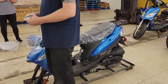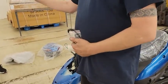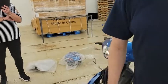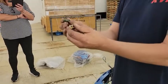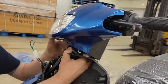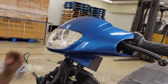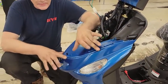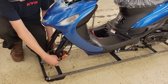The bolt holds the steering assembly together and a collar — the bolt is funny shaped, it's flat on one side and beveled on the other. I'm going to slide it on the bolt with the flat edge up against the bolt head. I'm going to slide it in and may have to slightly lift up on it as I push it in until it's flush all the way to the back. This is one of the first steps we proceed with because it helps make it easier to get the front steering forks onto the frame and keep it mounted down.